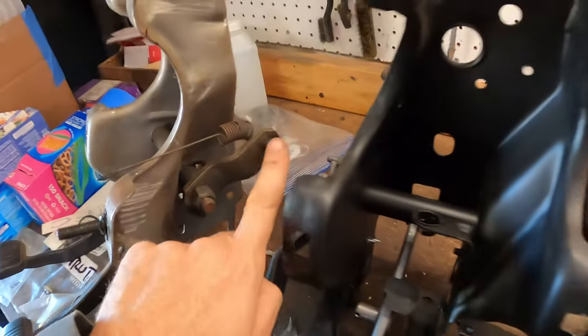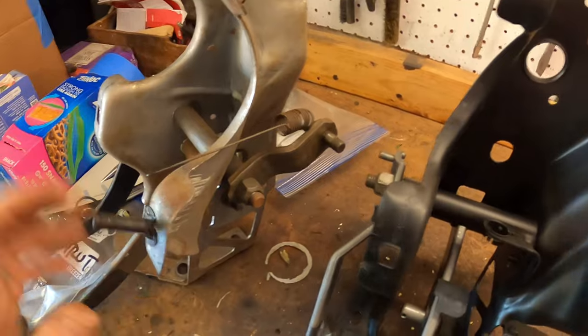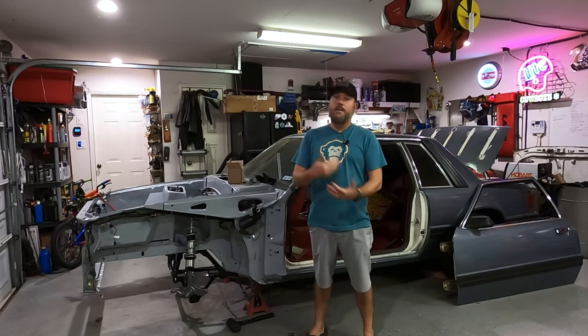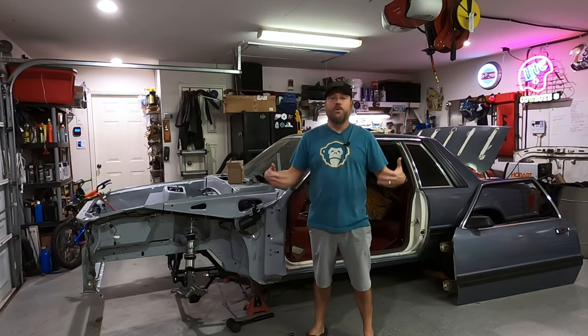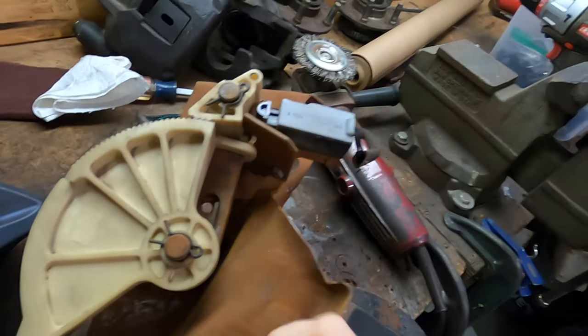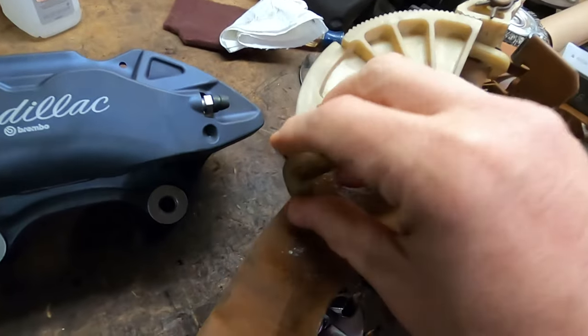On the late model Mustangs getting the T5s, like most people have in their cars, you have your quadrant here at the pedal. The quadrants were there to make up for any kind of wear and tear. As your clutch worn down or as the cable was stretched, you can simply lift up on the clutch pedal and that would click and make up for the slack. So it's essentially self-adjusting.